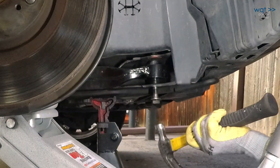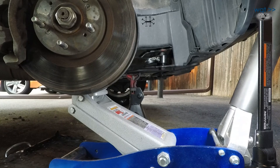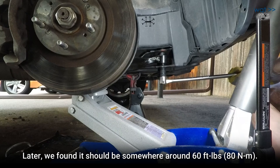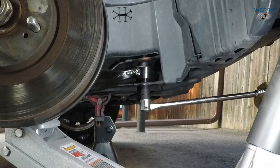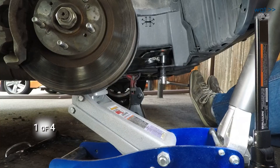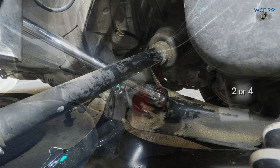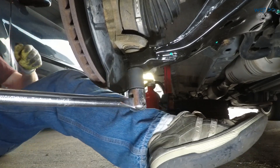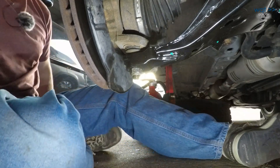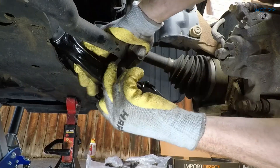That's a lot better. I'm going to go ahead and tighten that one thoroughly before I pull the jack back out, but I will release some of the tension on here so that more of the weight is on the jack stands. I should probably look at the torque spec for these, but I know how tight they were when I took them off, and I'm going to try and get them at least that tight again. Keeping in mind that these don't go into bolts — they go into those long threaded moldings on there, so they'll take torque, but not the same way they would with a hardened bolt. And if you ever wonder what foot-pounds are, here they are. I think that's about as tight as she goes.